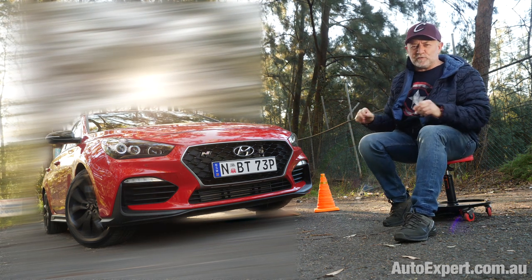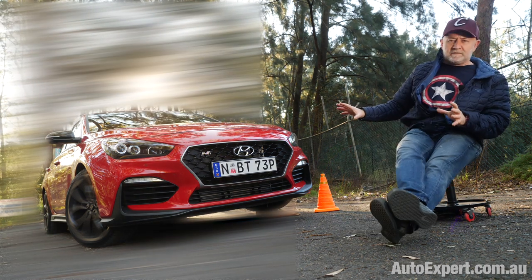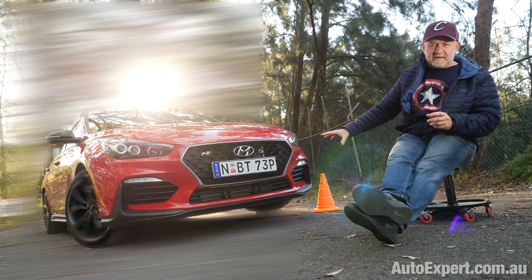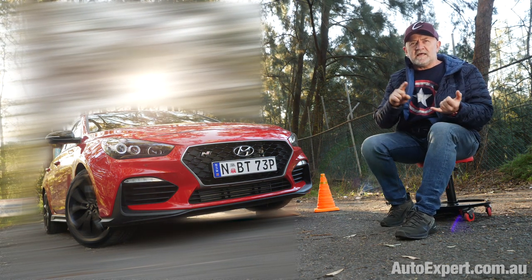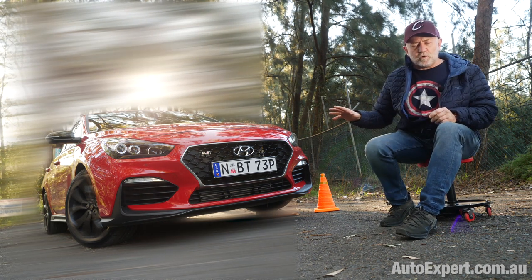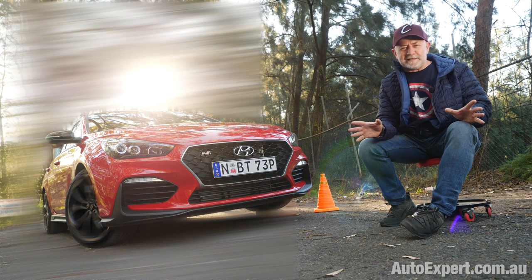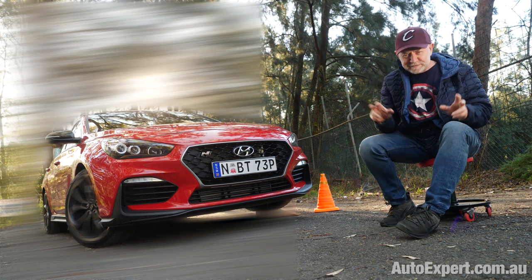The one thing I'm going to leave you with, though, is what does it feel like? What it felt like for me, I've driven the i30N on a track once, and I cannot believe how early you can get on the gas after the apex. In many situations in a car with an open diff, if you got on the gas that hard and that aggressive, what would happen is you would just push or understeer off the track. The inside wheel would spin, drive would be lost, and then all hope of winning the race is over a cliff, like a thousand lemmings in overpopulation mode.